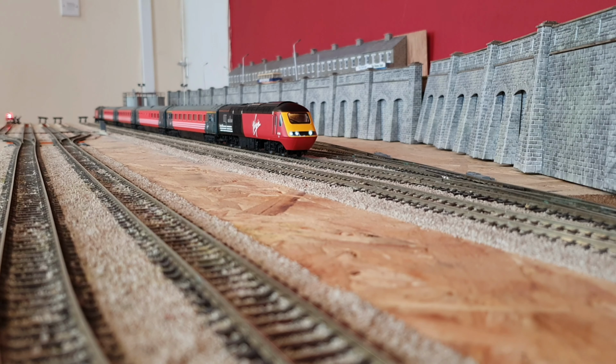It's just so that the computer knows that the driver hasn't fallen asleep or hasn't fallen ill and slumped across the pedal. Obviously, if the driver didn't release the pedal and put it back down, the computer would be going, okay, there's a problem, right, let's apply the brakes and stop this train. So that is the driver safety device.